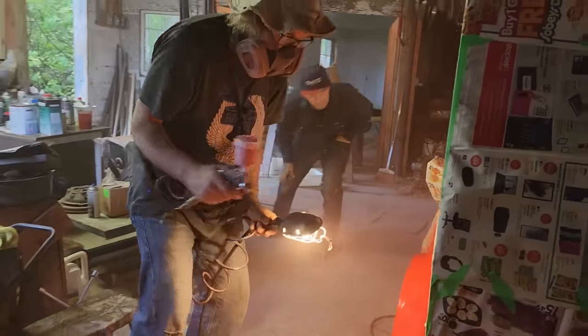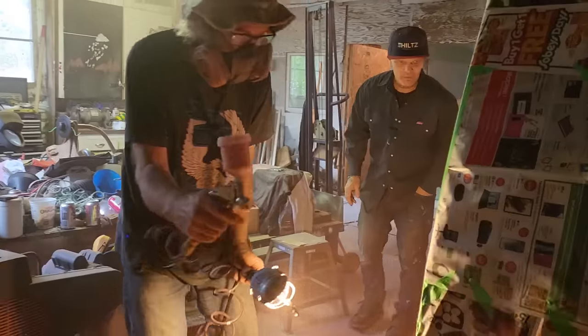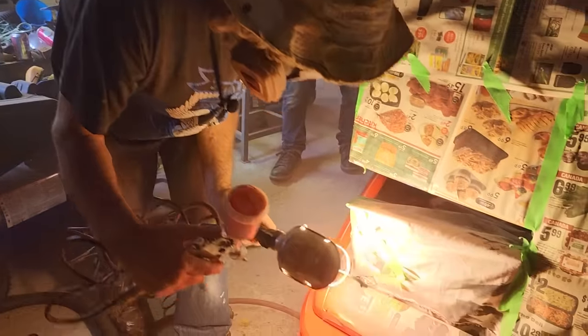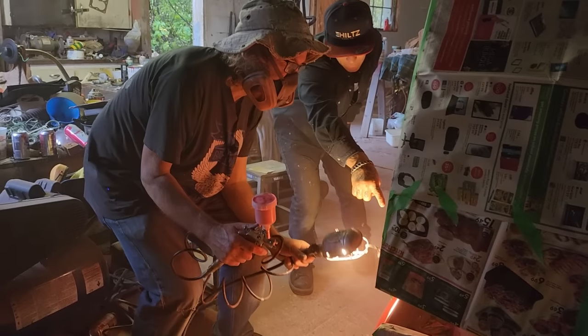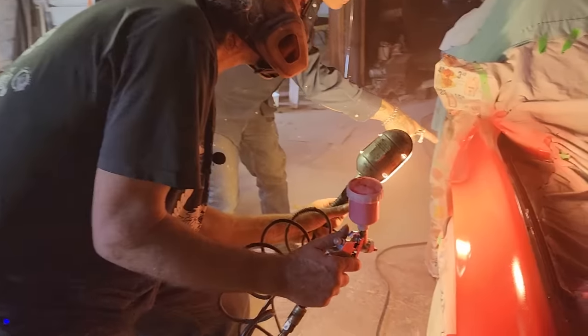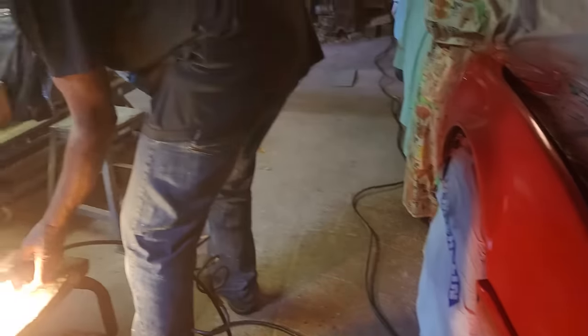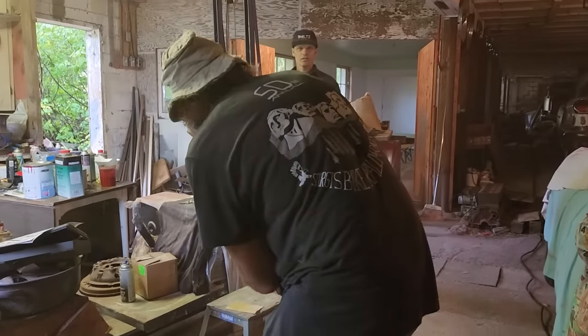Well, this fender didn't get any different treatment than the other fender. Okay, well, you had something that went on. I'd let it set for a bit. We gotta get that out. Just let that go. See how it missed that a little bit? That's going not too bad. I just keep going with that. Put it on dry for a little bit, because that paint's not thick enough in that gun to go orange peely on you. Have you noticed that? Yep.